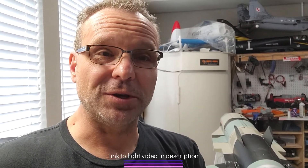I wanted to conclude the F-16 upgrade video — I'm super excited, the upgrade worked! This bird flew like a dream on the upgraded fan. I don't have the flight video because a friend with a better camera wasn't there, but I'll post that separately. The upgrade worked fantastic: much more power, much better verticals, higher speed, and the plane flies beautifully. At half throttle in turns, it doesn't tuck in like it did with the previous power system. We're getting close to a 1.0 to 1.1 thrust-to-weight ratio — just like the full-scale F-16.